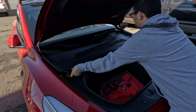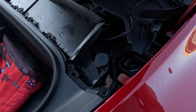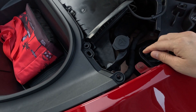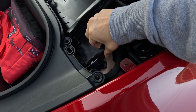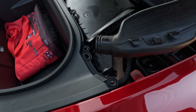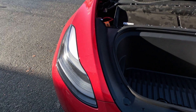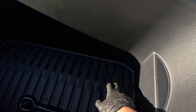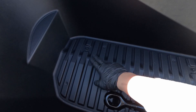Start by removing the trim in the frunk — simply pull up and pull away. Next, remove the washer fill tube. It should be held in place with a little plastic clip and the supply line should be tucked into the tube itself. I did not have a plastic clip from the factory, so if you have one you'll want to remove it. Before you can remove the frunk liner and the HEPA filter, you'll need to remove these four 10 millimeter bolts that secure everything in place. There are two on the frunk trim and two in the actual liner itself.